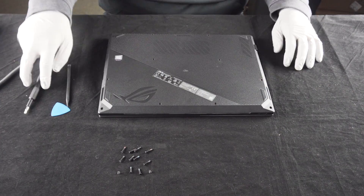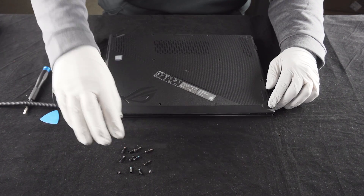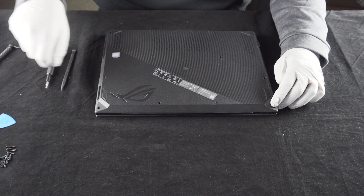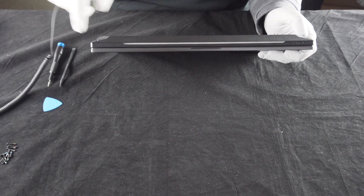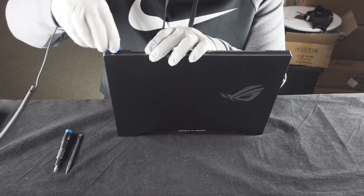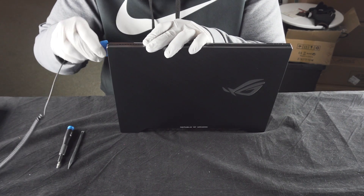12 total screws — only two short ones that go in the sloping corners, so that's easy to keep track of. We're just going to get them out of the way so we don't accidentally set the laptop on top of them and scratch things up. This laptop has a light bar, so we want to make sure we don't do anything that's going to mess with that. We're going to start on the corner with the pick until we get our first audible click.